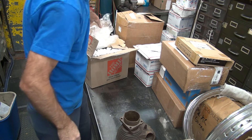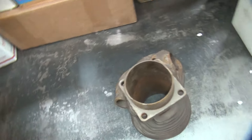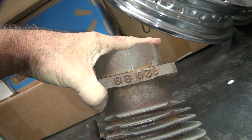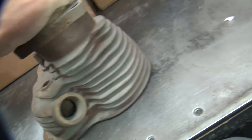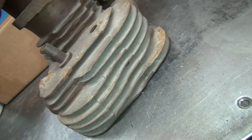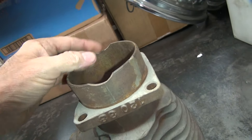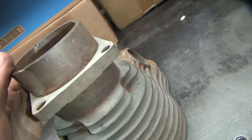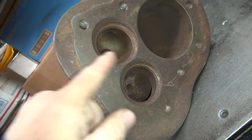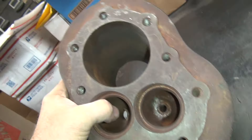There we go — one big front cylinder. VL? Looks like a VL cylinder. Nope — UL 38. Cut all the fins on it. Good sign. It looks nice. Bore's a little chunky right there, not too bad, kind of thin. The valves aren't sunk too awful bad. All the head bolts are there. The gasket surface isn't too rusty — just surface rust, nothing big.